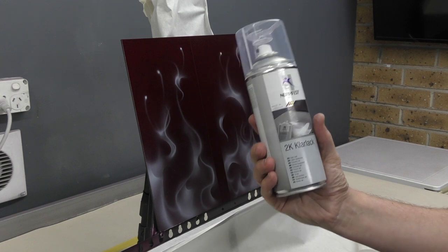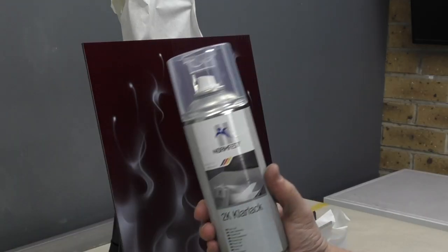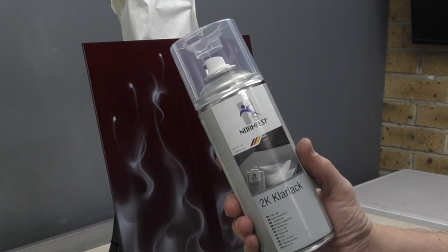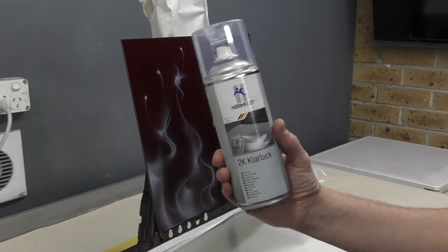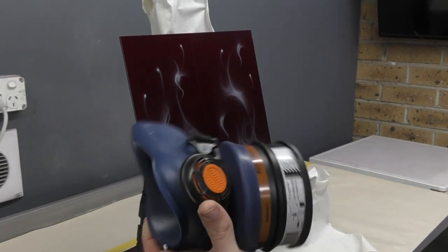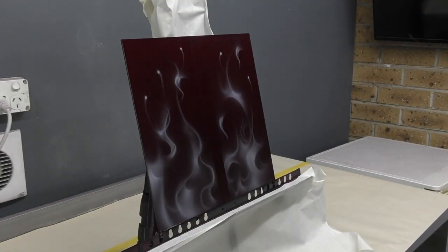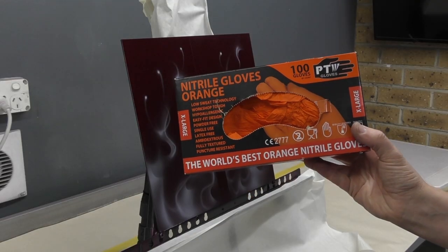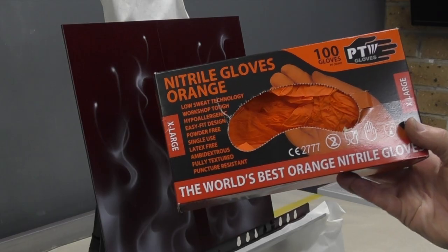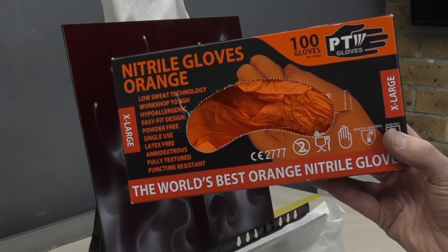Okay, so when using any 2-pack, even the other products that I've shown in this video, I highly recommend that you don't do this at home. You should really outsource it. But if you do end up getting yourself any of these aerosols and you want to have a go at home, be sure that you have at least one of these masks as a bare minimum, plus adequate ventilation. You also want to wear safety glasses and gloves to protect yourself. And with gloves, you want to wear a nitrile glove, which protects you from thinners. You don't want to just wear a disposable hardware glove.